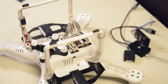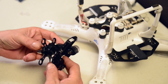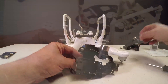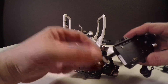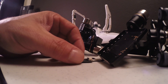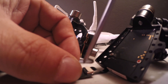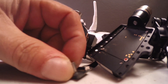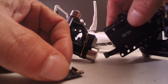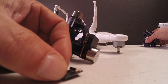We've got our new H4 3D gimbal that's brand new here. Before we put it on, we're going to do one other thing — we're going to use the connector from the old H3 3D gimbal and put it on the new one. That's really easy. This little black clip right here holds the ribbon cable in place, and if you pop it up you can pull the cable out very simply. I would hold onto that cable from the H3 3D because these cables break and it's always good to have a spare.